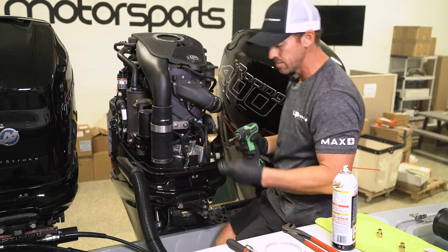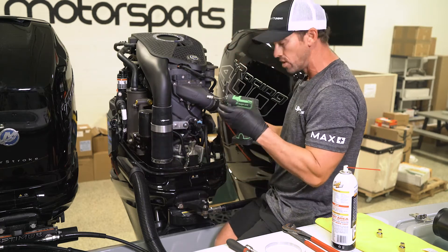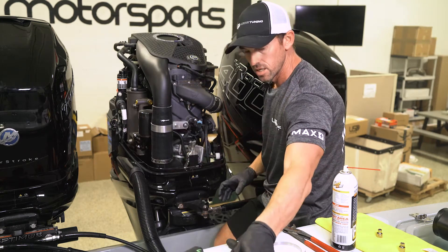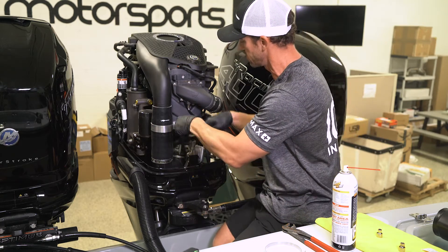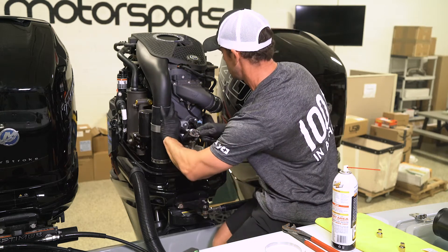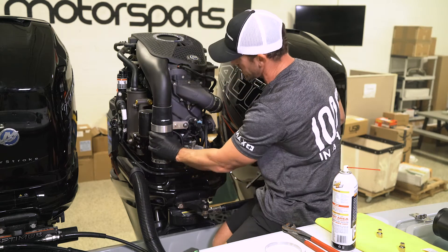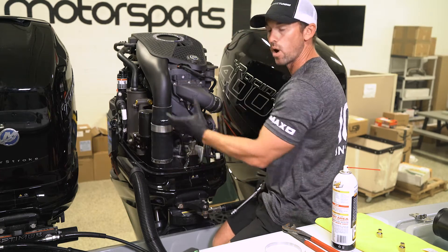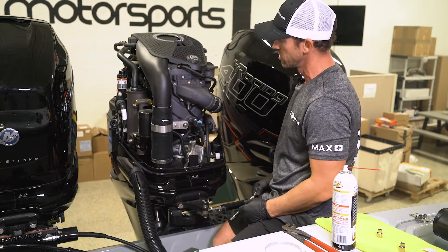Once I do that, I'll take the 10 millimeter and you want to screw this 10 millimeter down. Since this is just the mounting, you don't want to slam this all the way tight because it will compress the silicone a little bit. Essentially what I do is put it so it's nice and snug so the back piece is locked in. To get a better feel for it, you could use a hand tool, a ratchet, so that way you can feel how tight it really is. There's a piece in the back that you've got to line up because it slides in the groove. You'll see it start to squeeze just a little bit and that's about all you need — it's mounted, it is not going anywhere. It's secure with this four-ply silicone, and don't forget it is also wire reinforced, so that way when this big throttle body opens up and sucks a lot of air, it is not going to collapse that hose whatsoever.